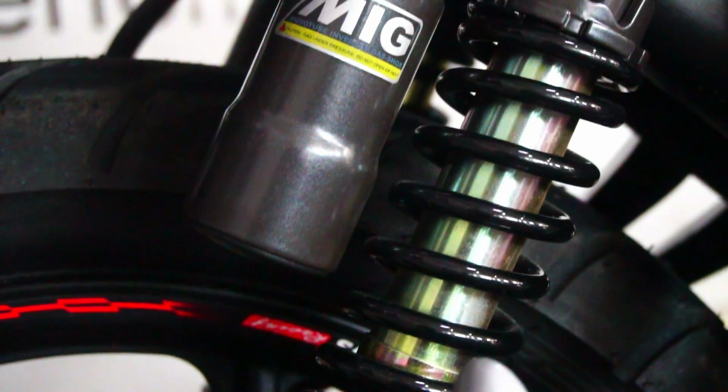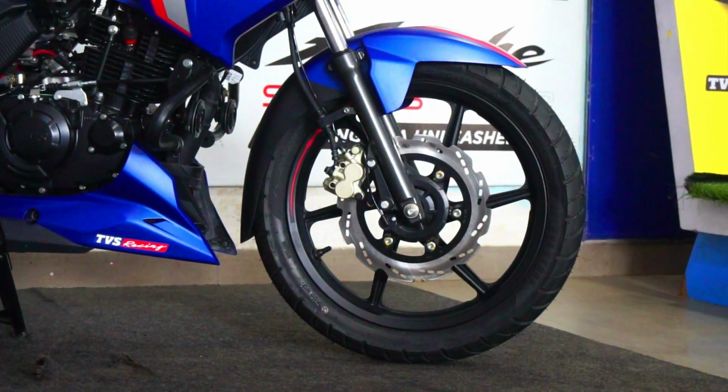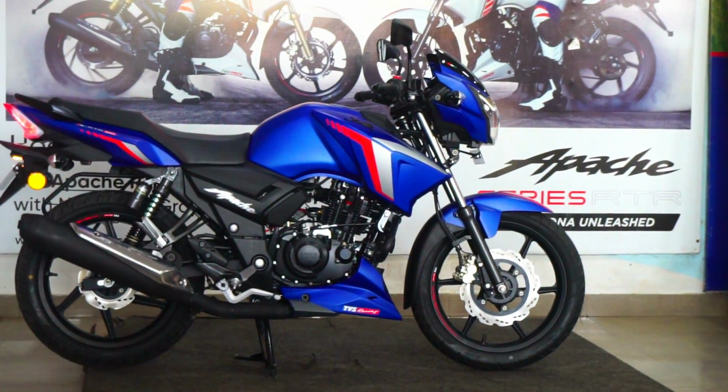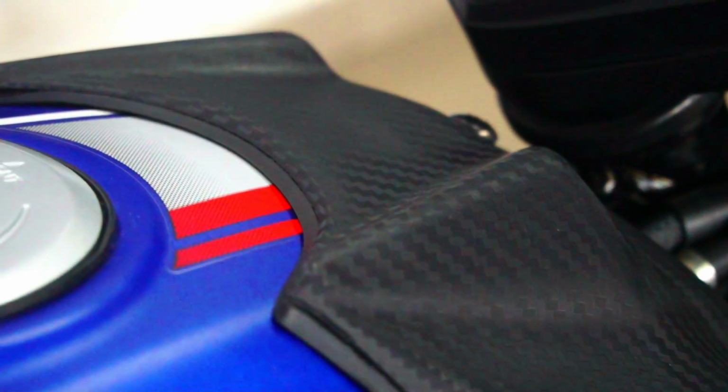Now talking about the brakes, we get a 270mm petal disc up front and a 200mm petal disc at the back. We get Supermoto ABS as standard, which is actually single channel ABS. Now this means ABS is operational only on the front wheel. Please do watch my What is ABS video where I explain how the ABS works as a life-saving feature. You can follow the video link in the description portion below.